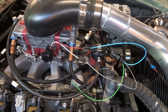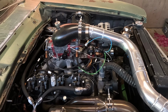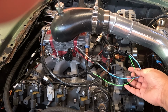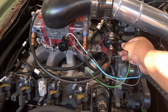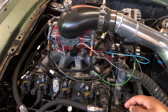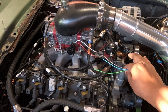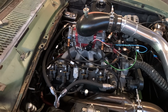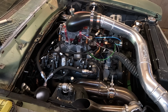The other thing to note with these Race Tech Direct, or whatever this TPS is called, so explaining the wiring pin out, you can ignore these 3 wires here. These are just from the extension. Completely ignore those. From the main harness, you're going orange to red, black to black, green to white, ignoring these 3 colors here. They don't exist in a regular harness. This is just something I added. And that's how you would get the correct signal for it to read TPS with one of these sensors without having to chop off the Terminator X original terminated harness.